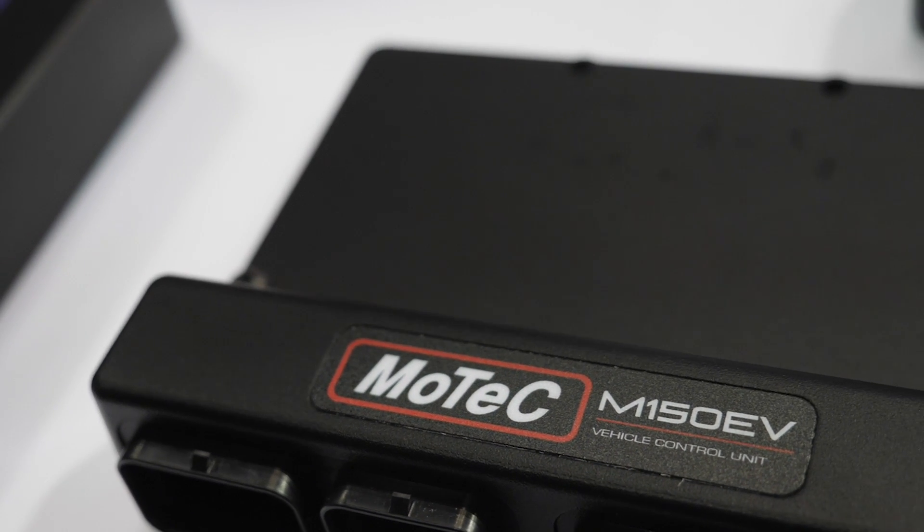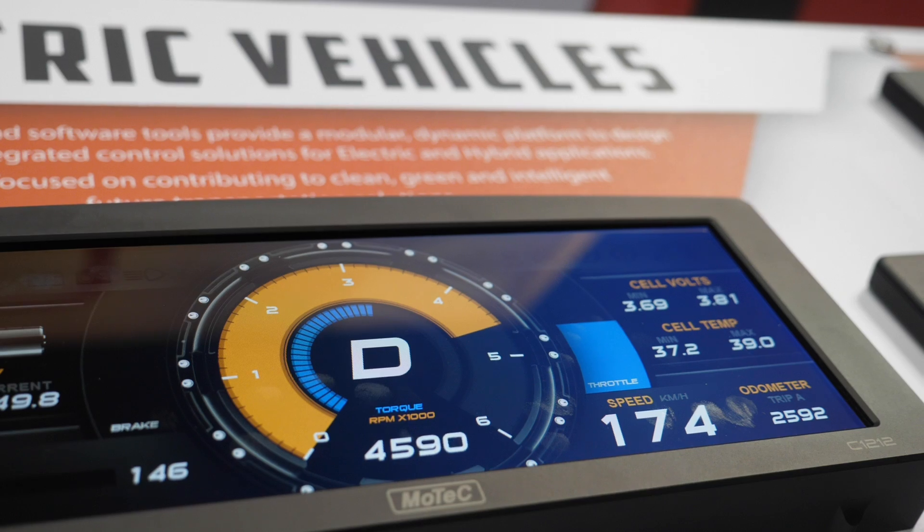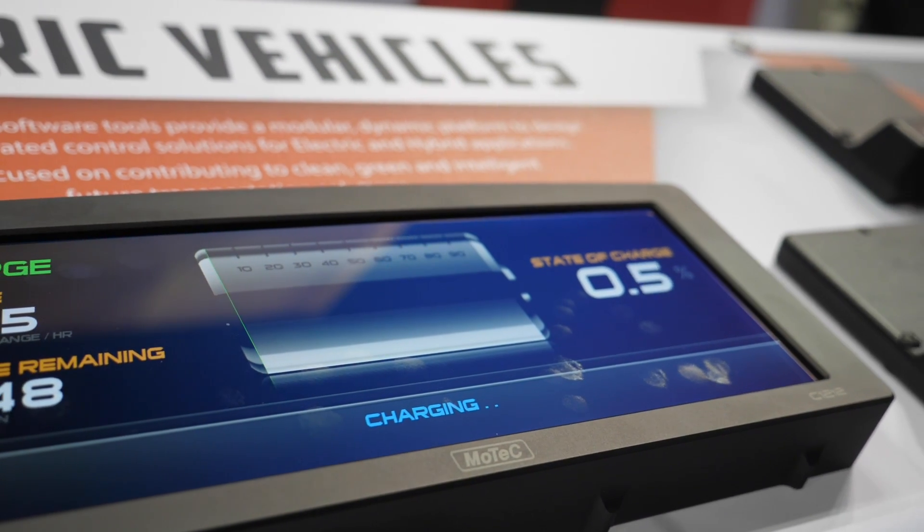So the advantage here with an electric motor is you've got much more precise control over the torque output than you have with an internal combustion engine. Does this give you more freedom with aspects such as the mapping of driver accelerator pedal versus requested torque, and aspects such as traction control, launch control, etc.? Yes, the torque is pretty amazing — you command a torque, put it on the dyno and it's a straight line, it's really exact. The response is quite cool, especially on tracks with chicanes and tight features, it just explodes out of the corner. And traction control isn't an option — it's a necessity.